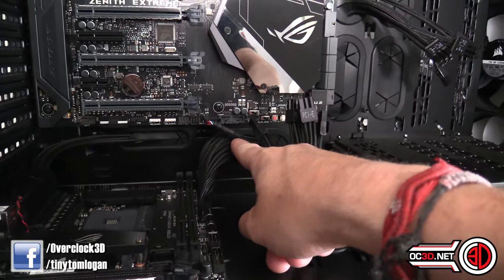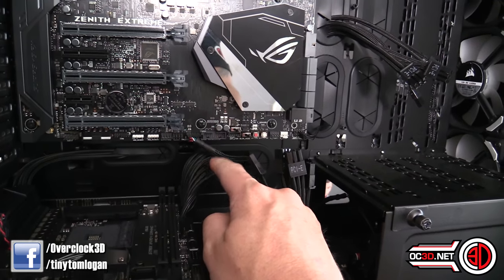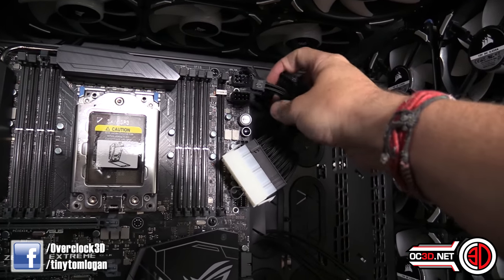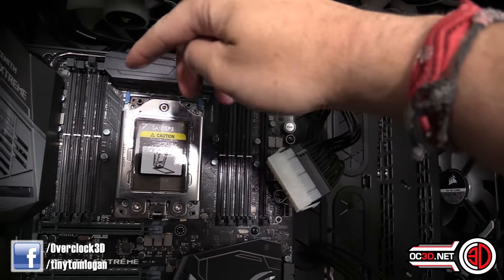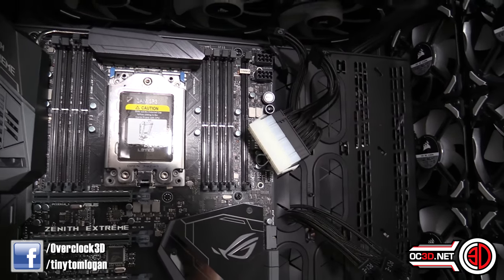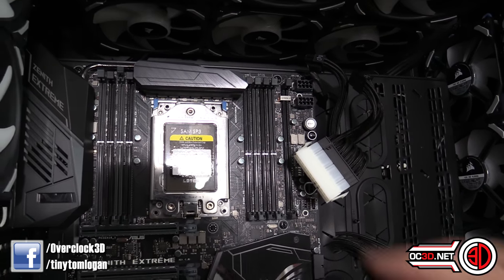The quality is still there but the cables are all black. We've got the shorter braided cables for the ITX and SF at the back, and then the fully fledged big long ones at the top. You can see we've got the two 8-pins up here ready, because on the Zenith Extreme you do need both of these plugged in. A lot of motherboards you don't need to worry about it, but this is one of the few times you do for all the power it's going to need.